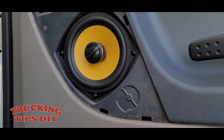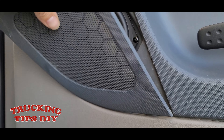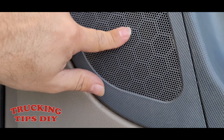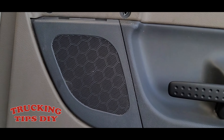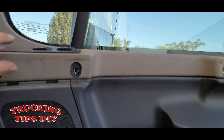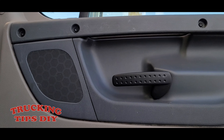That one is ready. For the cover, all you gotta do is put the two clips right in here and then push it up, pressing the clips in. You can see there's a little gap right there — that's how I'm gonna leave it. It's not putting too much pressure into the tweeter, just a little plastic. I'm gonna put this handle back in here and it's secure now. That's basically how you put in your door speakers.